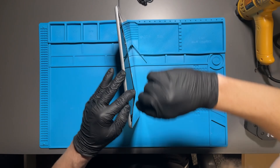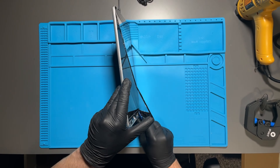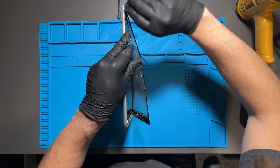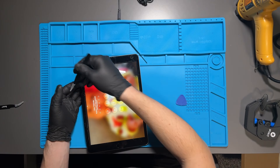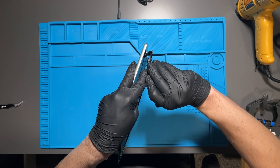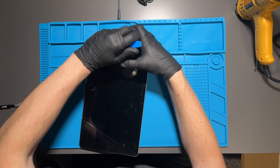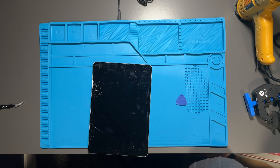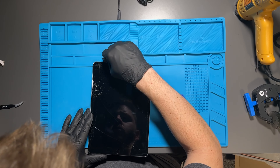You don't have to use the anti-clamp. Most replacement kits you purchase online for these front glasses will come with some form of suction cup and that should work just fine. However, if your glass is cracked all over, a suction cup probably isn't going to work — instead you'll need to heat the screen up well and go in with a razor blade or pry tool to pull the glass away from the adhesive.